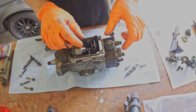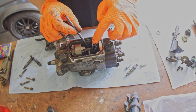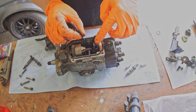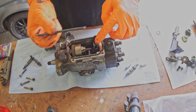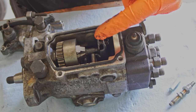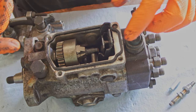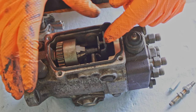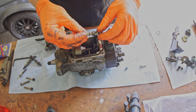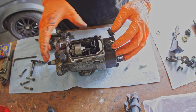Down in the very bottom of your pump is a collar that's attached to this lever. And if you open it up and you have it apart like this, you'll be able to see the collar. And basically how these pumps work is this collar covers the ports on your fuel plunger. So this collar entirely determines how much fuel goes into the car. The more this way everything goes, the more the collar gets pushed up the shaft, the more the ports get covered, the more fuel goes into your car. So if we turned our fuel adjustment screw all the way in and we had our throttle wide open, you have the gas on the floor, it would look like this.